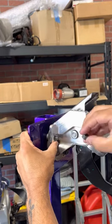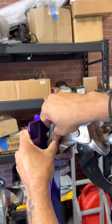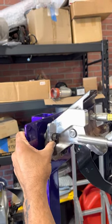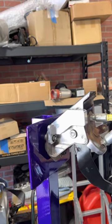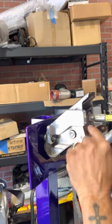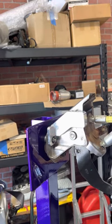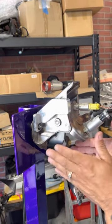So with that installed, you put your 12 millimeter back on there, you could use the same existing nut, and that's it — tighten it up. This is what it does: it pulls down the clutch pedal assembly, applying pressure here, so when you are pushing down it's not gonna flex on you anymore.